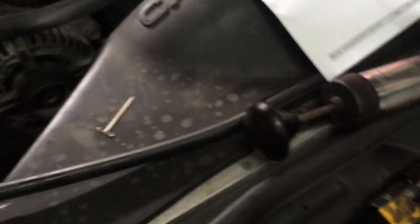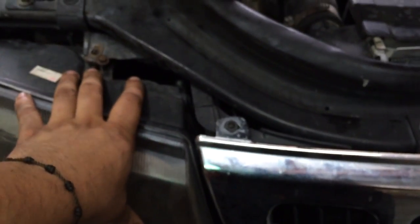I don't know if you can hear it, but you can see that moving — the fans do work. After doing a little more research, I found out that these fan relays, which are not in the fuse box but actually under here, go out pretty easily. I've already tested it and confirmed it was a bad fan relay.